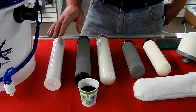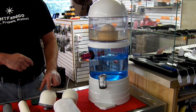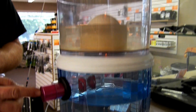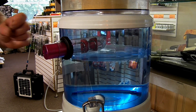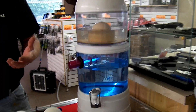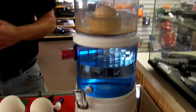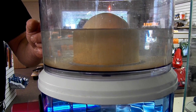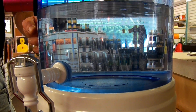So this gives you an idea of how all this works. In our countertop system that we ship around the world, this uses the active carbon ceramic dome filter. And you can actually see it dripping. In some of our products we have addressed the virus issue through electronic means — our system here actually uses UVC. UV light in a certain wavelength from 100 to 250 nanometers actually sterilizes pathogens, virus, and bacteria. It won't allow them to replicate. So that actually handles virus particles in this system — we filter out the heavy particles and lead from the main filter, and then address anything that might have slipped through in the lower container.